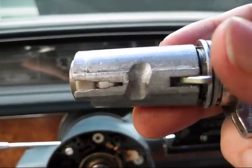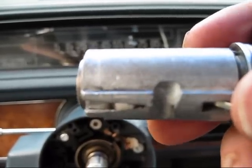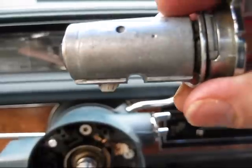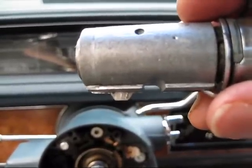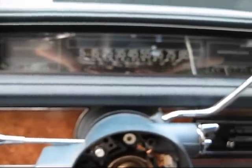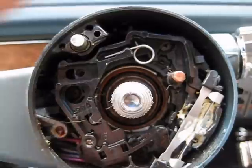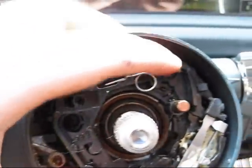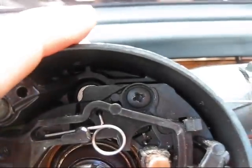Here's the bottom of the old lock cylinder. See that little white tab there? That's what activates the buzzer switch when you put the key in. Also note, it's not spring tensioned or anything — it could just slip down, and the spring tension in the switch is what actually holds it up. So you might have to use a little screwdriver that goes in the little slot there to hold that tab up so you can put the buzzer switch back in. Reinstall the turn signal switch and screw in the three screws. To get to the top screw, make sure that the switch is in the right position so you can get to that top one there.